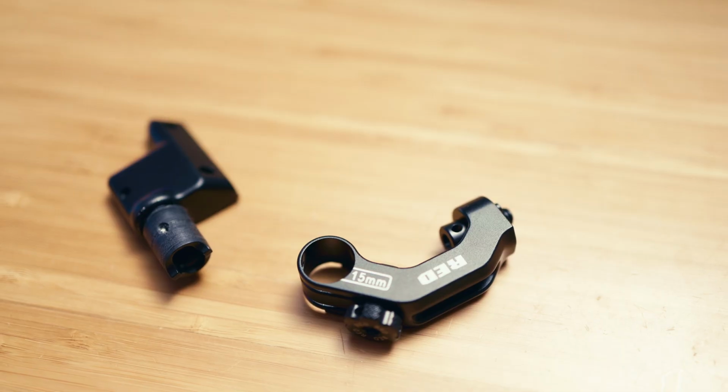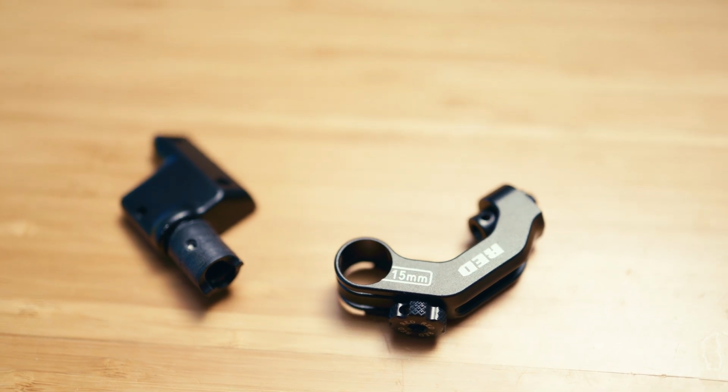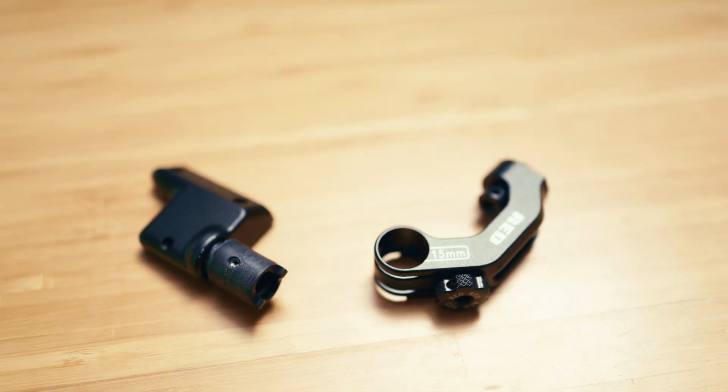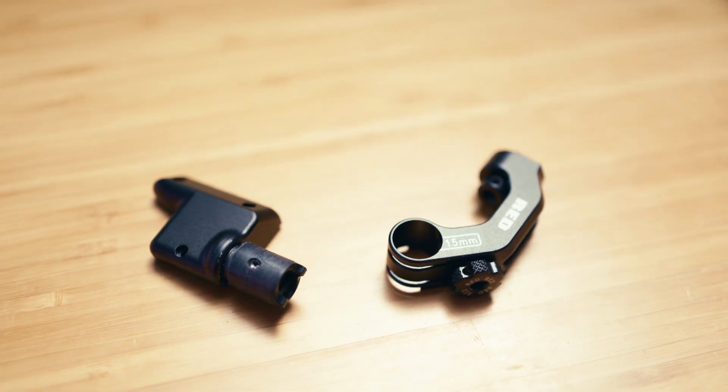The original DSMC3 hinge is partly an aluminum part, and then it has a nylon bearing sleeve on top held in place with these 2 really small countersunk screws. And the problem is that those screws can tend to back out and then scratch the clamp and then seize and bind, and it's a whole mess. And Red introduced the upgraded rigid hinge, which is aluminum clamping aluminum.